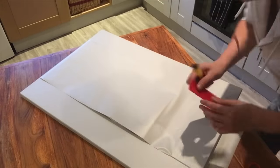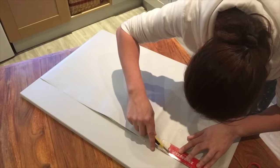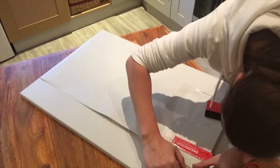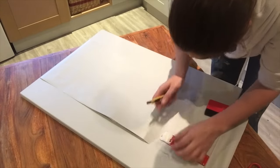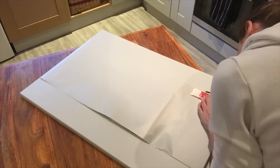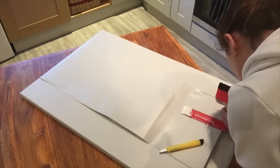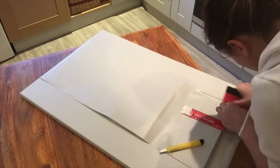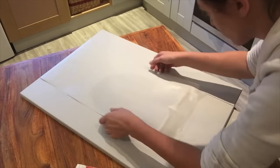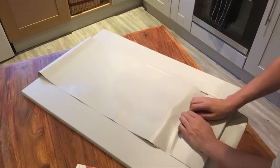Make a slight cut in each of the corners where you're going to push down into the middle panel — this makes it a little bit easier to work with. Also trim off any excess on the indentation ridge. Try not to push through too hard; you don't want to cut underneath. Once the excess is trimmed, push into the ridges again with the square edge of the squeegee — this will make sure that everything is tightly tucked down and stuck together. Press the product over onto that edge that fits down into the middle panel — be really careful with this.